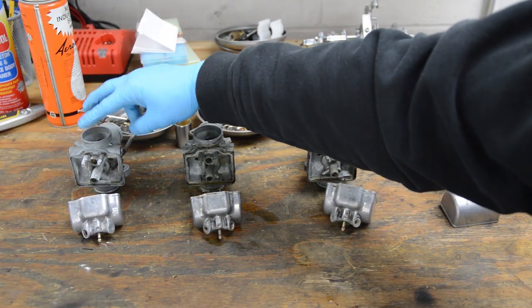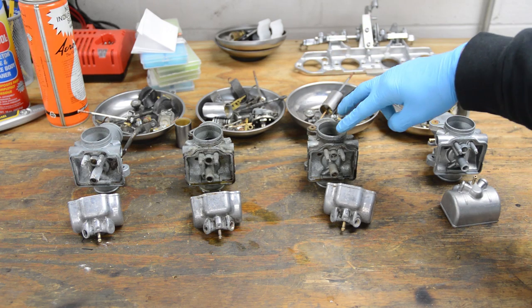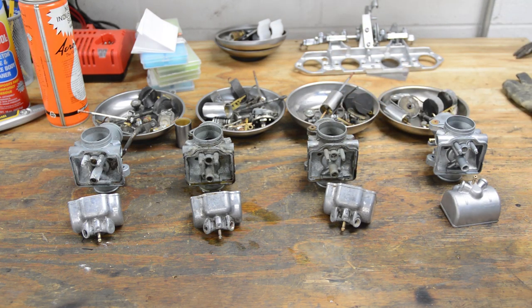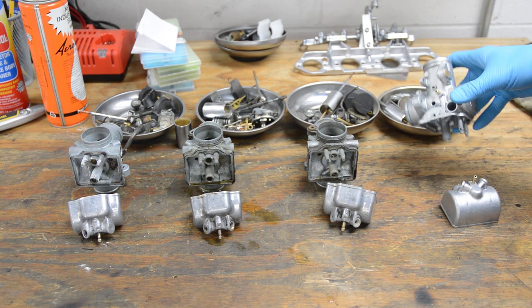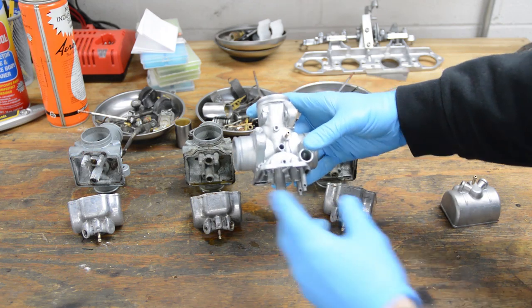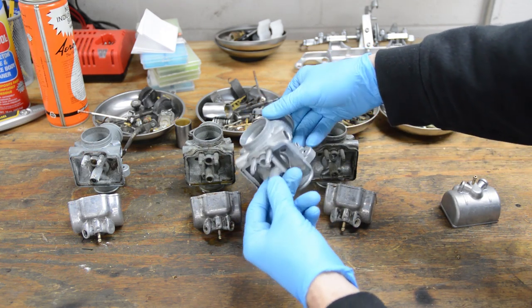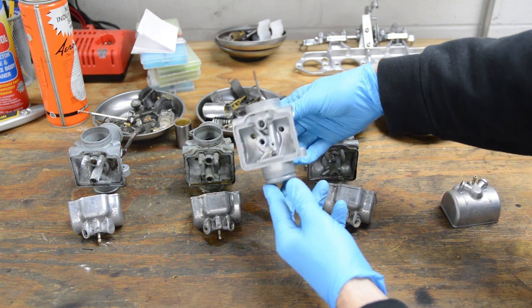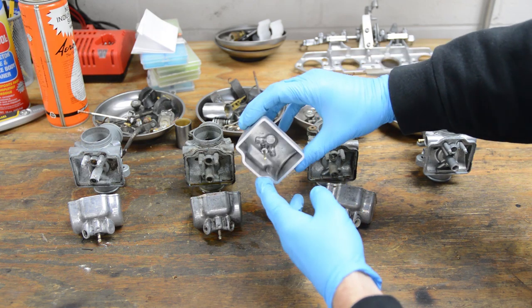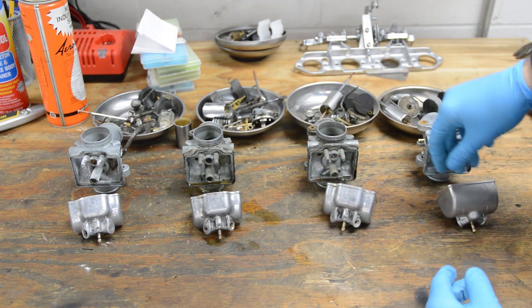Okay, so over here, this was an ultrasonic tank. This was the Berry Man. This is untouched here, and this over here is vapor blasted. Actually, I ultrasonic these first to loosen up the grease, but as you can see, the vapor blast finish is perfect. It's brand new. Okay? Just takes all that crusty stuff off and looks really good.